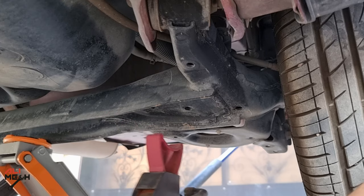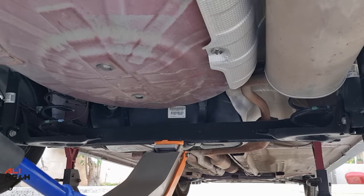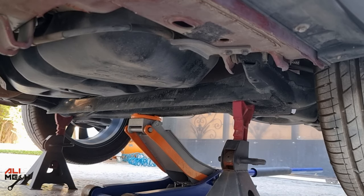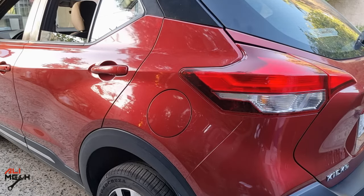Here I will do both sides at the same time while the car is still on the jack stand. Now I can lower the car onto the jack stand, but I will still keep the jack under the car for extra safety. Push the car sideways — it should be stable and not wobbly. Now we know the car is safely on the jack stand.